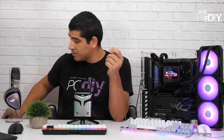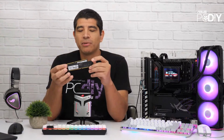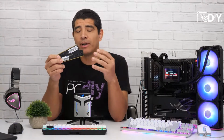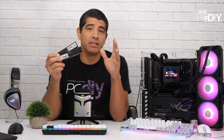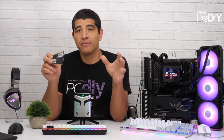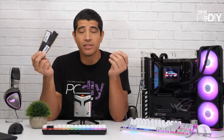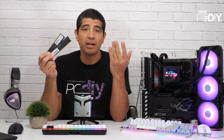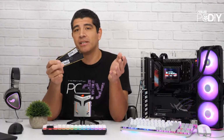so you're using memory once you install the memory. Most of the memory kits that you're going to probably be purchasing are going to have an XMP profile. The XMP profile will define the frequency, the timing, and the voltage for the memory. And in most situations, it's also going to define an overclocked frequency. It's not going to generally define a base operating frequency that the platform is designed for. In the case of Z690, the base frequency is 4,800 megahertz, but you can very easily run much higher frequencies, 5,600, 6,000 megahertz, and even, for some IMCs, higher than that.